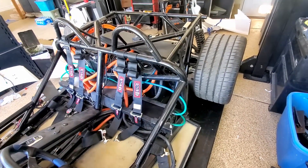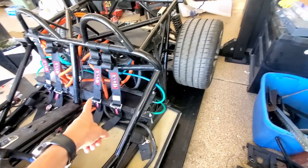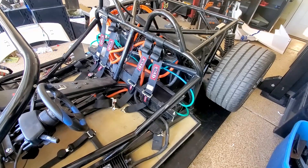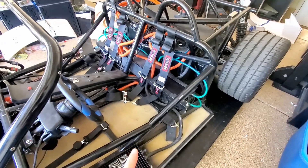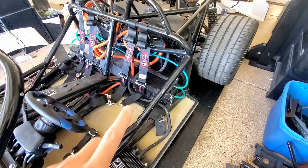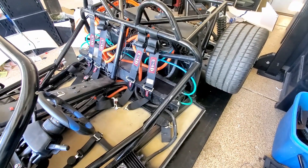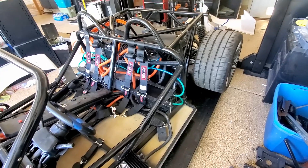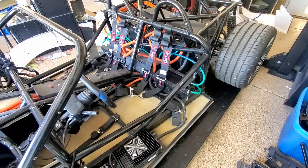I'll do a quick summary of things we tested and learned. We got into the high voltage box and he had a special meter. We hooked it up to the high voltage side and to the chassis - the negative battery terminal and then the positive. The negative seemed to be okay, but the positive didn't have enough resistance between it and the chassis. We started doing a few things and ended up making it worse - so we kind of disconnected and moved some things around, and ended up with more of a direct link to chassis.